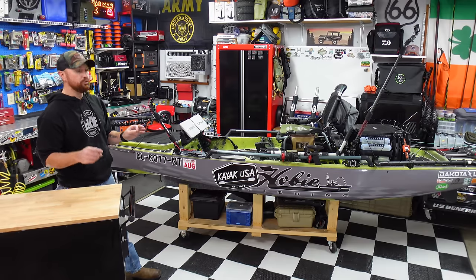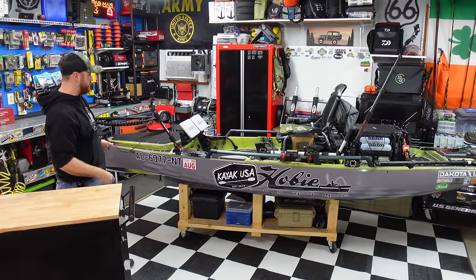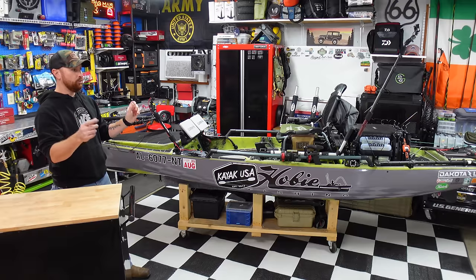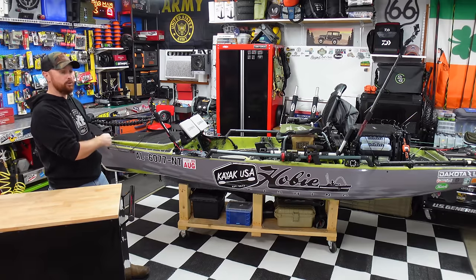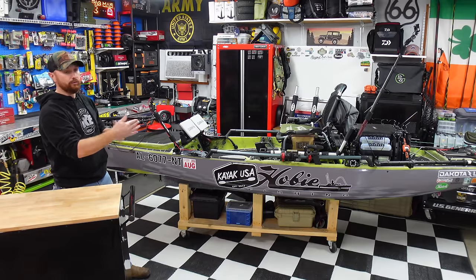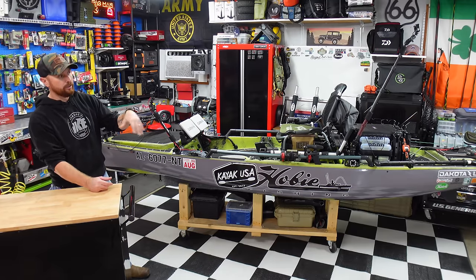Another thing is to use masking tape and pre-place it before you peel the back off of this wrap. So you've seen me, I used masking tape and I made sure that I was centered, because you've got a little bit of leeway with these wraps. There's a little bit extra on each end, and you wanna center it up how you want it. You definitely don't wanna just start peeling and sticking it, because if you start at one end and you don't pre-mock it up, you could get to the other end and realize that you were way too far over, and you don't wanna get down there and have 3 or 4 inches short of wrap material. So you wanna make sure you can cover the whole side. Just mock it up with some masking tape.